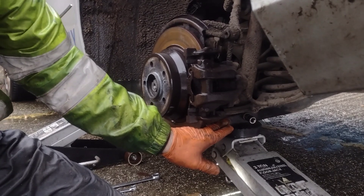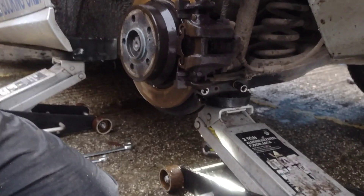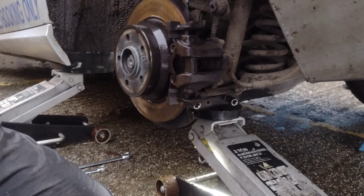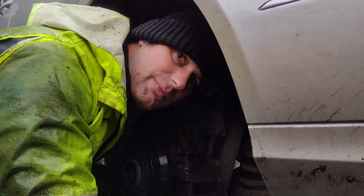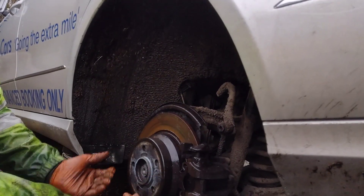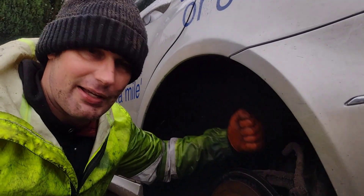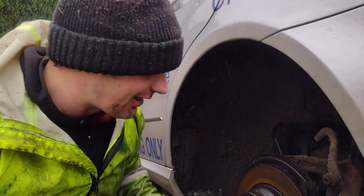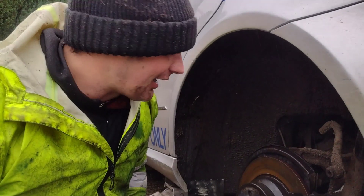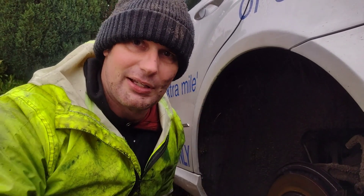The thing to watch with this is, although I'm supporting this, the arm's not going to go down because I've still got a shock absorber bolt, so it can't go down. But watch you don't have your head in here whilst you're watching what you're doing, because this lock comes up, and this thing will get you in the head. Because it's a bar, it concentrates the area into one tiny bit.